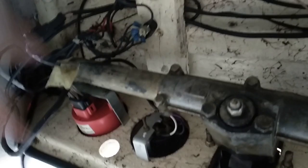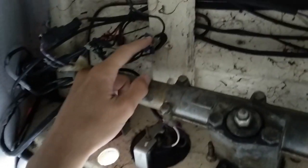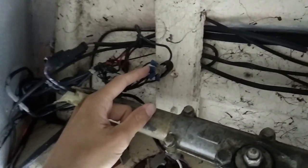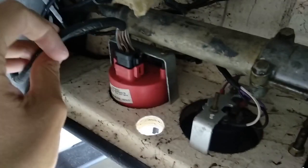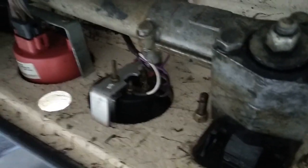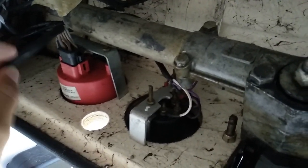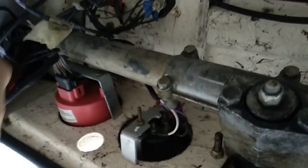Having a look under the dashboard — this is where the voltmeter is going to come through. I've got a ground, I wouldn't even call it a bus bar, more like a bus pole — it's pretty heavily stacked at the moment. I'm going to see if I can add one more to that. Then I need to investigate these cables along with the manual to identify what's happening with the accessory lead, to make sure I tap the right one. That will give us the power we need at the right time.